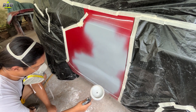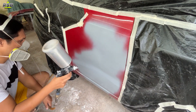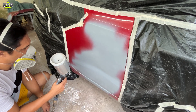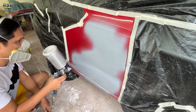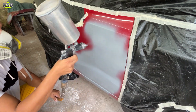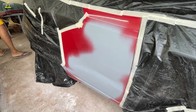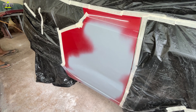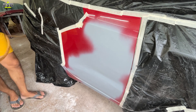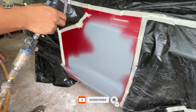Before applying the primer the panel was looking uneven — up and down — because on some spots there was body filler and on some spots it was missing. Now after applying the primer, as you can see, my panel has become so flat and the body lines have come through. I cannot even tell that I did body work under this primer. You will have to acquire a finish like this through the sanding process — the entire thing depends on the sanding. I am applying two coats of primer and I am now applying the second coat. If you found this video useful, like and share it with your friends and family, and subscribe and press the bell icon so you don't miss any future videos.